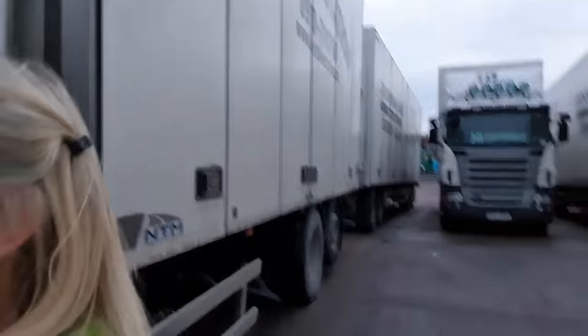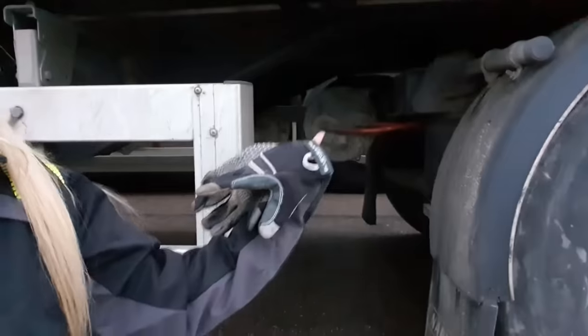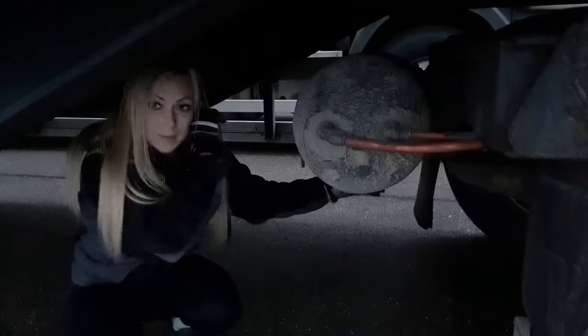So what I am going to do now is drain the tank one more time from air, just to make sure that the alcohol has passed through the hose and into the tank again. In that way we are safe on the air brake at least. If you look closely now you can see that the alcohol has gone into the tank - look at this. And that is how you fill the tanks with alcohol and prevent the brakes from freezing during the winter. So now you know how to do that.